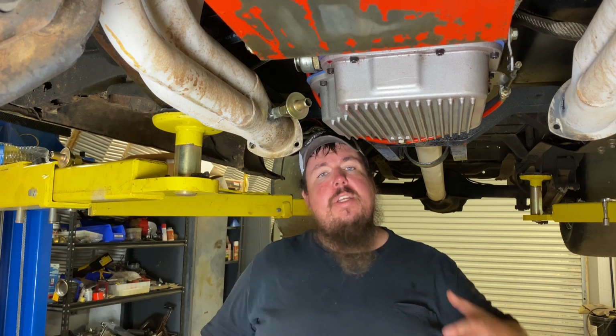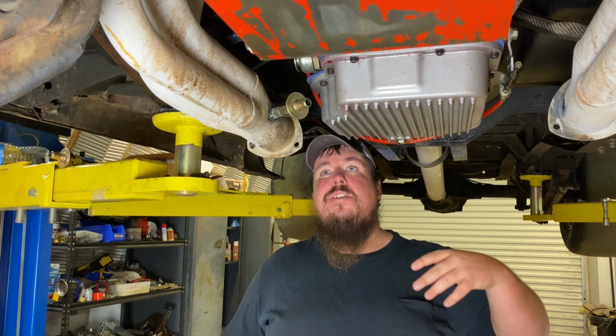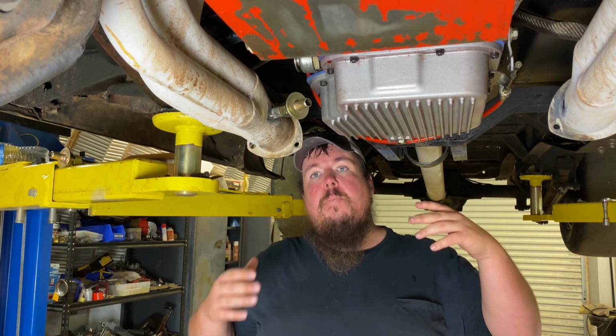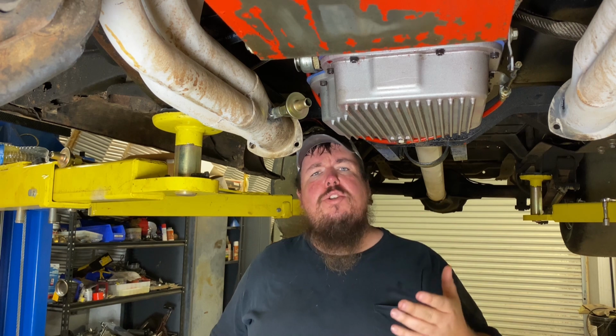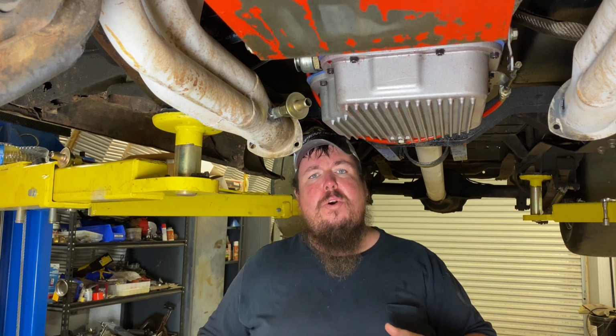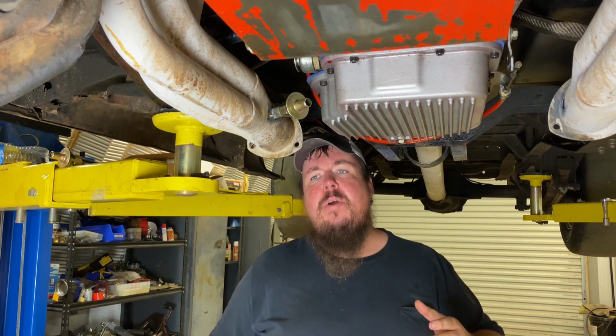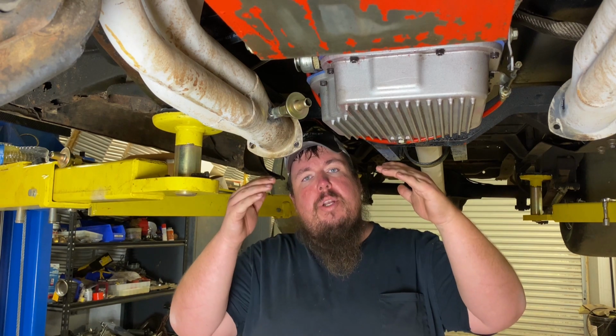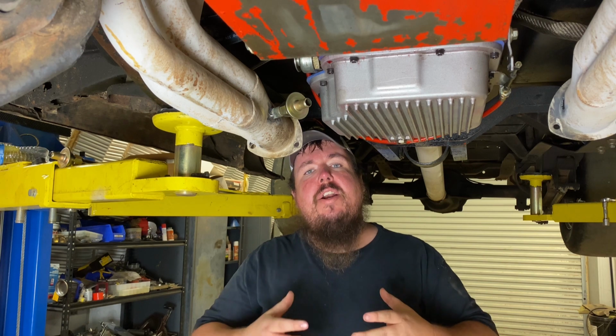And it's a pretty simple and easy kit to use. So that's why I'm using it on this, because it's dirt cheap. And those other kits, like your belt-driven pumps and stuff, they're made for more of your full-on race setups that people are using on boosted engines, on supercharged or turbocharged, or cramming a lot of nitrous on them. They'll actually build the bottom end of the engines to have low tension rings, and then they'll put a good vacuum on the bottom of the engine to help seal the rings tighter.